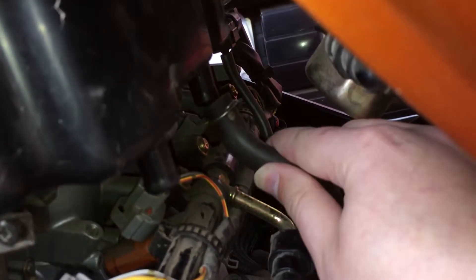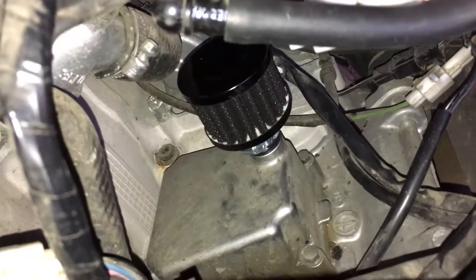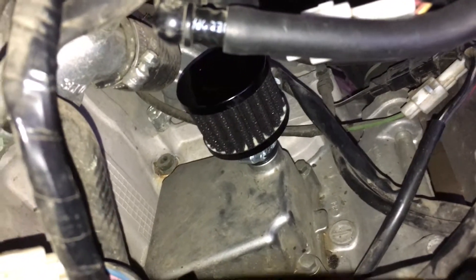There's the dirty, oily sponge. What I've opted to do is instead of the PCV hose being routed up to the airbox, use a breather filter directly on the PCV, as you can see. I've removed the PCV hose entirely and closed off those ports with bypass nipples so as to seal my airbox again.